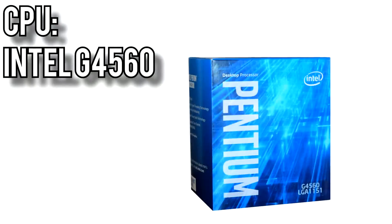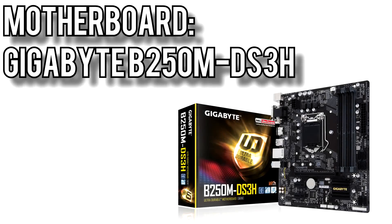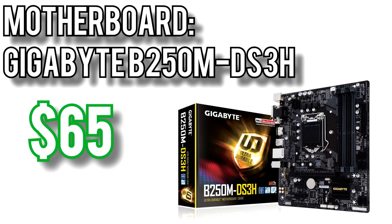First up we'll look at the $500 build. I recommend $500 as the starting point because below this budget you'll be cutting some serious performance corners, though I do have a lower budget plan for the not too distant future. For the CPU I picked Intel's G4560 for around $85. Despite being on the LGA 1151 Gen 1 socket, going with the G4560 does allow you to upgrade in the future. You can go as high as an i7-7700K with 4 cores and 8 threads without needing a new motherboard. For the motherboard, I went with the Gigabyte GA-B250M DS3H Micro ATX board for around $65. Because the G4560 is a locked processor, there's really no need to spend more on an overclock-ready motherboard when we can apply that money elsewhere.